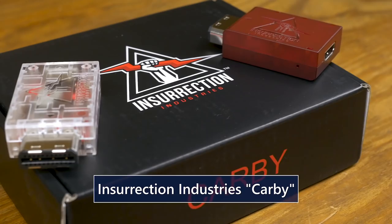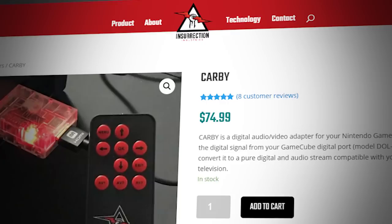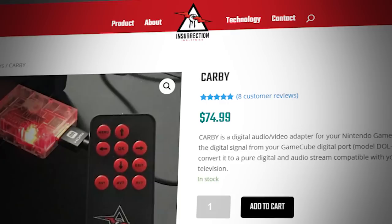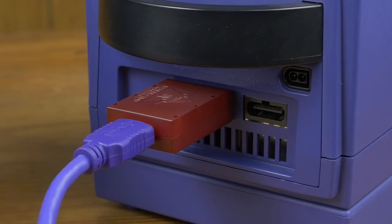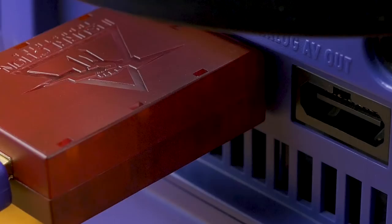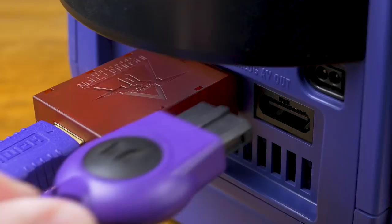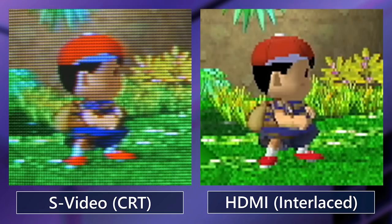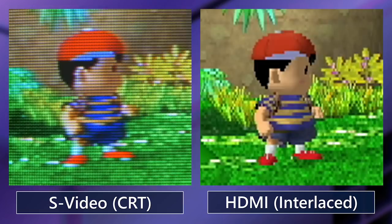The Carby by Insurrection Industries is an attractive, smaller HDMI plug-and-play that features an astounding reproduction of the official Nintendo digital connector plug — it looks so good and clicks in just right. The Carby has an attractive price too, costing only $75. While this unit is clear plastic and runs on firmware 2.4a, Insurrection is currently transitioning over to selling units with 2.4b along with some additional shell options. Anyone interested in updating the firmware may do so via the internal JTAG connector, or by sending the unit to Insurrection for service. Since the Carby only occupies the digital output, it's possible to simultaneously use HDMI alongside S-Video on NTSC consoles or RGB on PAL consoles, as long as progressive scan mode is not engaged. While this limits you to interlaced output, it could be useful if you wanted to play on a CRT while sending a digital signal to an HDMI capture card for a stream.